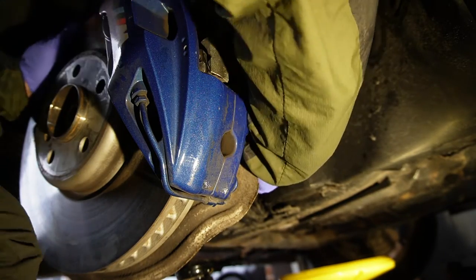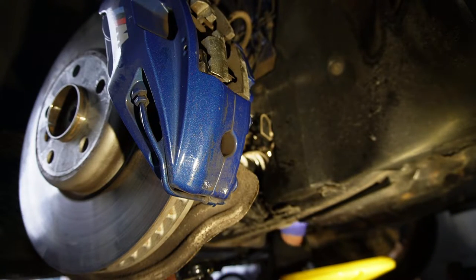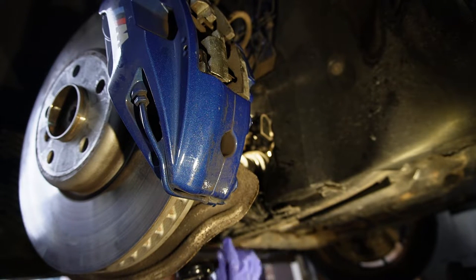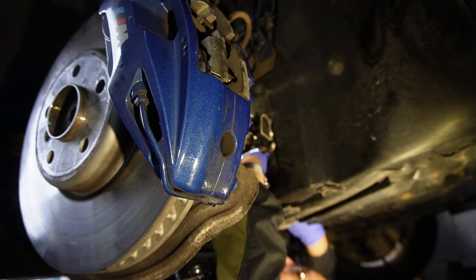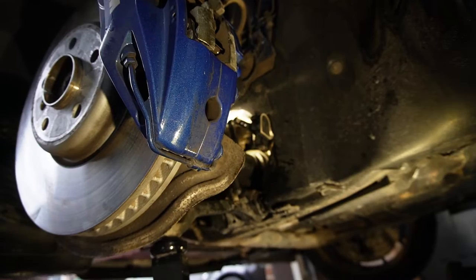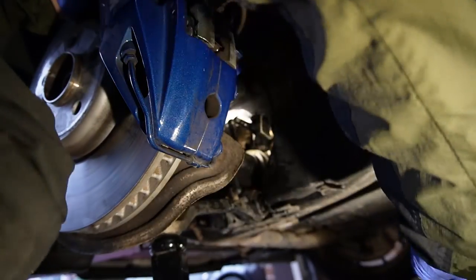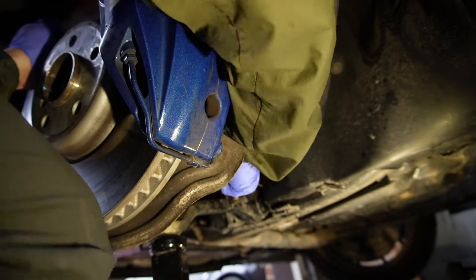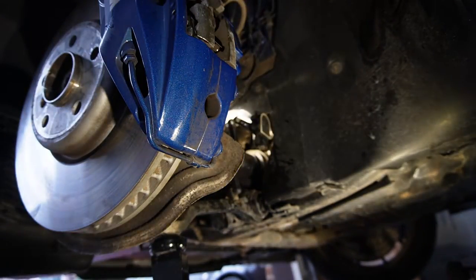Made a mess on this job, but we're basically done. I apologize for not getting perfect footage — the tolerance is really not forgiving at the fill plug side. You've got your headlight leveling sensor, control arms, and everything in your way, and you don't want to break any of those. I dropped the fill plug twice at this angle and finally decided to hand-tighten it from underneath by the drain bolt. A tip: jack up the lower control arm slightly so the things in your way are less of a hassle, allowing you to fit your extension combination into the fill plug.